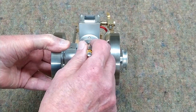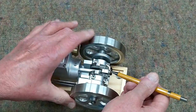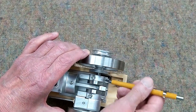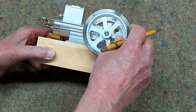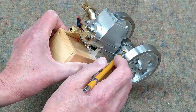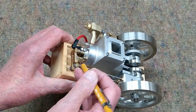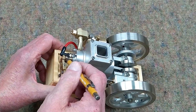You want to oil the upper end of the connecting rod on the wrist pin inside the piston. You want to oil this bushing on the lower end of the connecting rod. The crankshaft runs in bearings, but dribble a little oil down in there. Put some oil where the pushrods go in around that brass, and oil these points — put some oil on the springs and up here on the tappets.